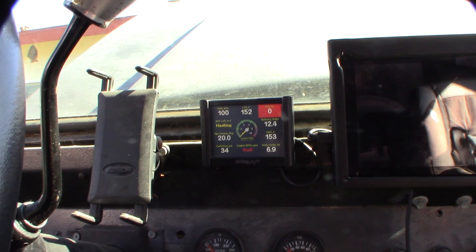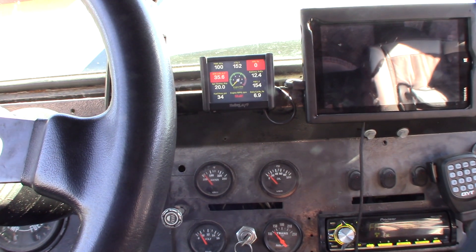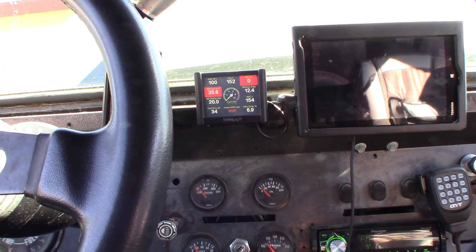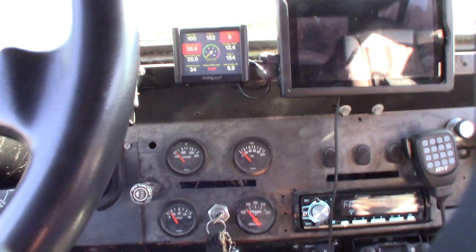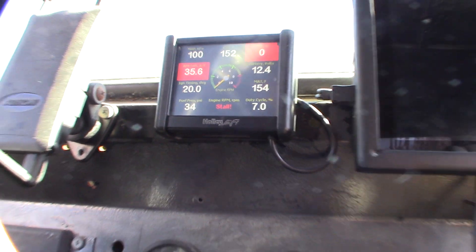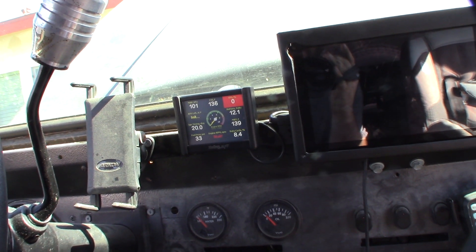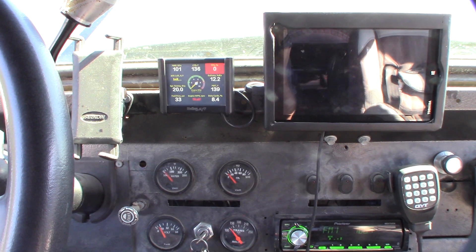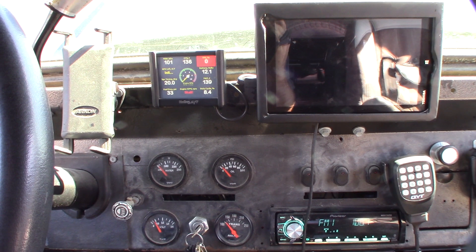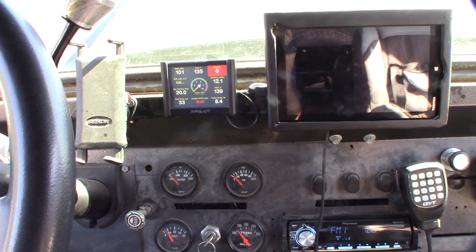This usually isn't a problem with factory cars because they have a check valve — also called a check ball or anti-drain back valve. In electronics it's called a diode: only allows current one way. After waiting about 15 to 20 minutes the gauge is still reading 33 psi, so this isn't really an accurate test. I need to get the engine really hot to replicate the condition.